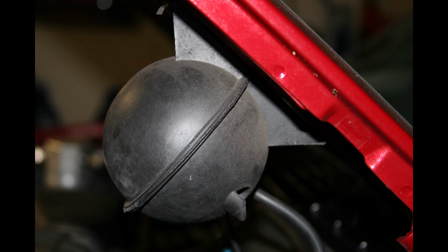I had a problem with my air conditioner blowing out on the floor on my 1997 S10. Check the vacuum supply line to the reservoir to make sure the reservoir is getting vacuum. When you pull a vacuum on this vacuum reservoir with a tool like a Mighty Vac, or you can just use your mouth, that should hold vacuum. So you need to check your vacuum reservoir first.